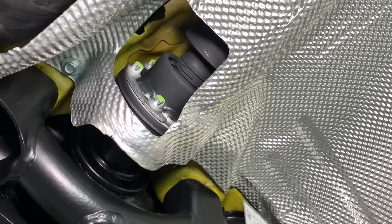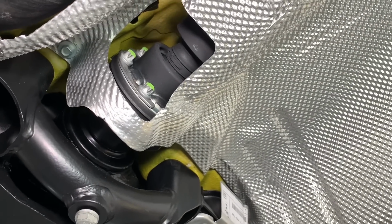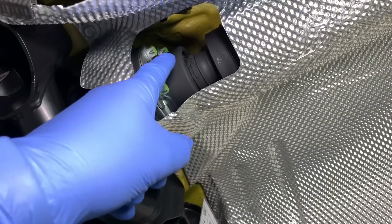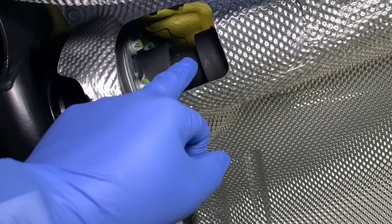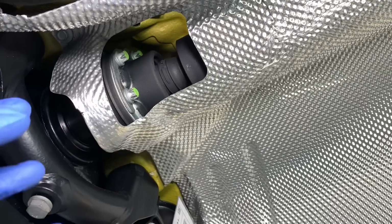There we go, we've got a little bit of it visible there. It's had a new prop shaft. Not an overhauled one, not a replacement, not a used one, a genuine BMW brand new prop shaft to remove that inherent play that they get in the ends of the splines. Not the CV joint. Lots of people think the CV joints wear, but that's a real misconception. It's actually the splines on the end of the prop shaft, inside that CV joint, that are poor, and this car was suffering a little bit.